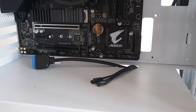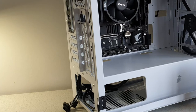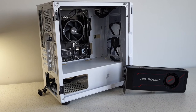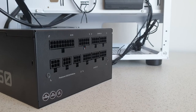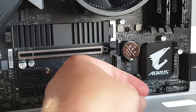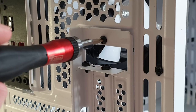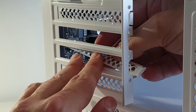There's a decent amount of clearance around the edge for those awkward front panel connectors. There are plenty of cable access hole options, but they are just plain holes — no fancy rubber grommets here. However, the case does score some unexpected posh points with its ability to allow you to mount your GPU vertically; we won't be doing it here but you can if you want. Down in the basement a hard drive cage keeps our drives in place, and there's plenty of room for our Gigabyte fully modular 750 watt power supply. One thing to bear in mind with this motherboard is that the graphics card slot doesn't line up with the normal top slot of the case — luckily I spotted this in time. You can also temporarily remove the vertical GPU bracket if you want a bit more room to see what you're doing.